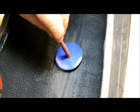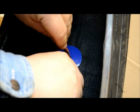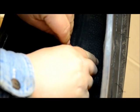Select the appropriate size repair. Center the repair unit over the injury and outline the area one half inch larger than the unit so buffing will not remove the crayon marks.